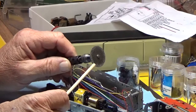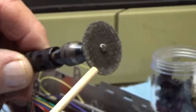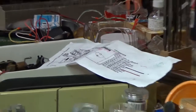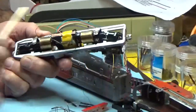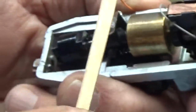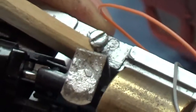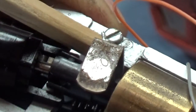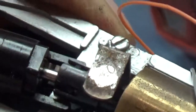Take your time with it. The very thin cutting wheel — the one you would use to cut rail with — will break and shatter. So you take this thing outside and you score it, and it'll cut through very clean. When you get through, what you're going to wind up with is a piece of metal that's cut off. In this particular one, we were able to get that metal piece off the rivet — it wasn't on there tight and was actually causing loose connections. You may have to drill out and set a screw in to get a good ground to the chassis. Later I'll show you how to use a brass washer that the screw goes through so your wire connects to it and makes a great connection.